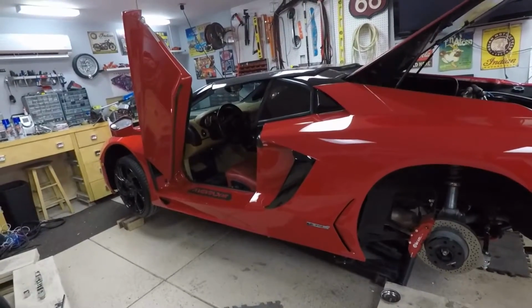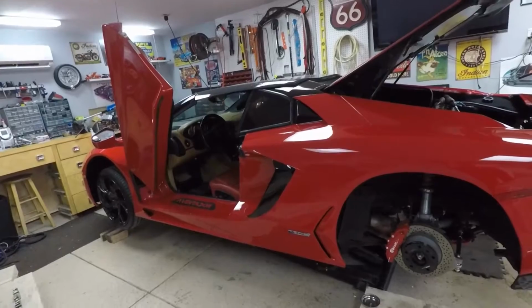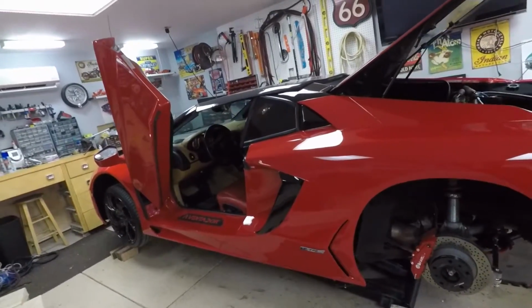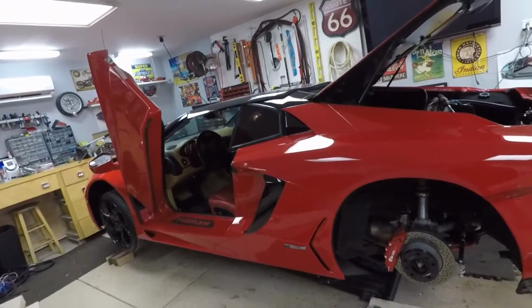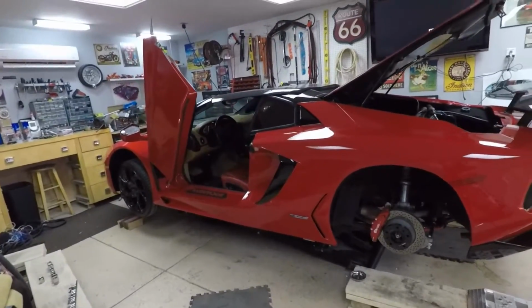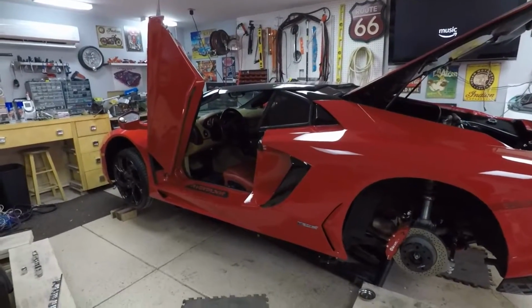That'll focus your effort on the two possible broken items, the solenoid or that little wire that runs alongside the fill tube. Not troubleshooting all these other hoses and connections. And the interesting thing about that is sometimes the trouble codes you get on cars can mislead you because they're so generic.